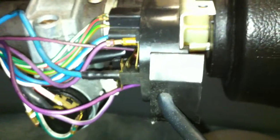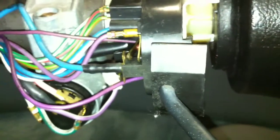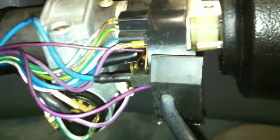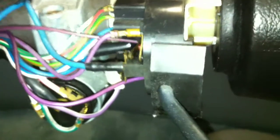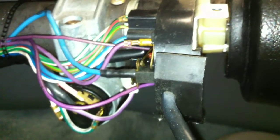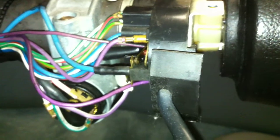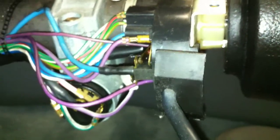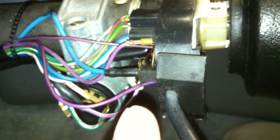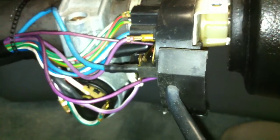When I had that piece of paper in there just to temporarily make the high beams not stay on, the way I had it fitted so that it wouldn't do this is that the paper actually pushed it back really far, so it actually turned on the high beams by going back here. The interesting thing is when the car is not on, this will turn on the high beams, but pushing this so the metal lead touches the back like that doesn't turn on the high beams. But if you turn the car on and turn on the headlamps, this will turn on the high beams — and that only makes sense because when you're driving and you click this back to turn your high beams, it locks in place and connects there, turning on your high beams as well as your regular lamps.